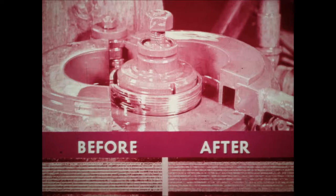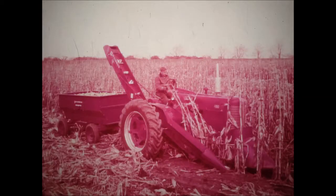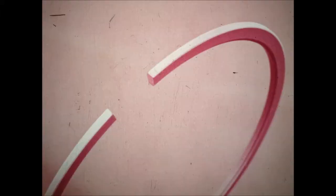All IH rings are lapped at the factory. The rings are run in against cylinders of critical laboratory standard dimensions. The purpose of this additional step is to minimize the break-in period and give your engine maximum power immediately. Thick chrome plating gives rings longer life and improved performance. At the same time, it reduces wear on pistons and cylinder walls.